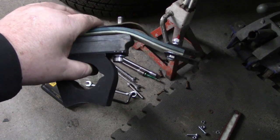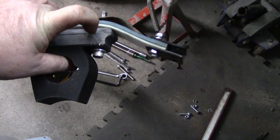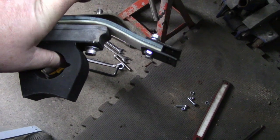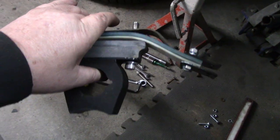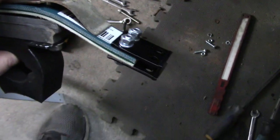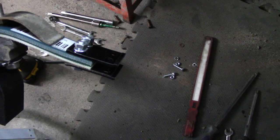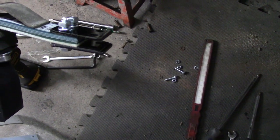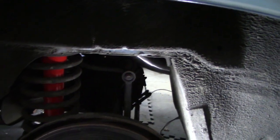The driver's side assembly is just about to go on. Don't forget the anti-seize — put it on the entire length of the bolt, because a lot of times it'll seize actually in the aluminum block. Pull the bolt out, coat it with anti-seize, put it back in. One other tip: put the top assembly linkage on now because it can go on at this stage, making it easier than struggling with it when it's on the car. That way you've only got the lower link to do up and you're good to go.